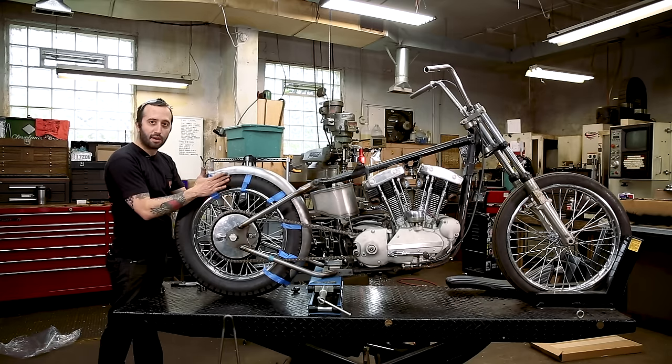It's kind of the same thing as the bungs on the fender. I'll show you later when this bike's actually going back together, we're going to clean the paint off of that surface. So it bolts really nice and flat, metal to metal, because the sissy bar is going to be chromed, that one's going to be chromed because it's not stainless. And so it won't be smooshing paint or anything. It'll bolt really nice and flat, metal to metal.